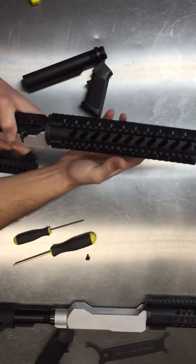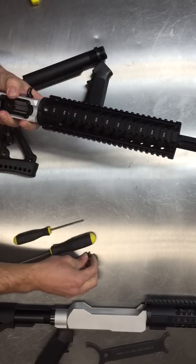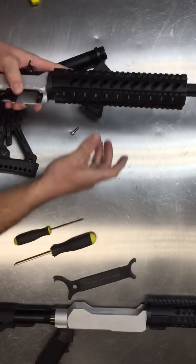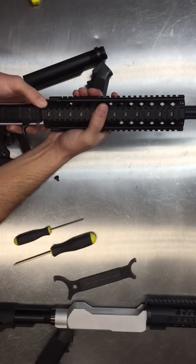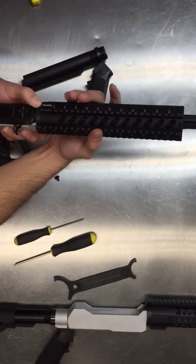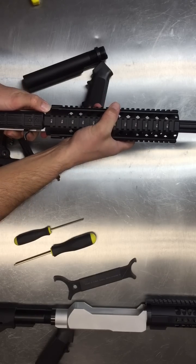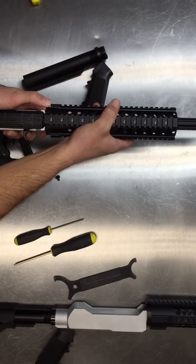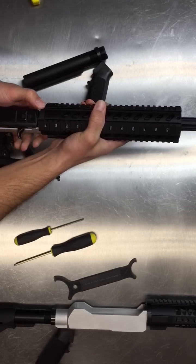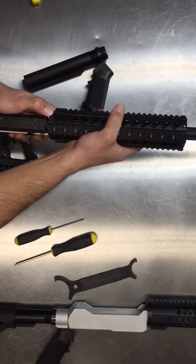Alright, now this is where not using the tool, you know, if you use a tool, put your nut in, crank it down, pretty good, but I don't like to do that. I like to snug up the lock ring, spanner nut, get it so it's just starting to come in snug. See right there, nice and tight. I can keep going if I want. I'm going to back it off, turn the spanner nut a little bit more, and crank it down.